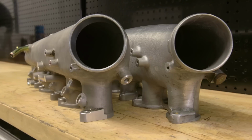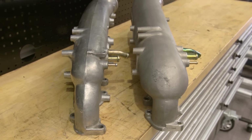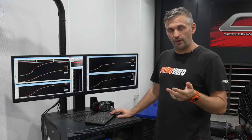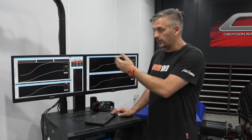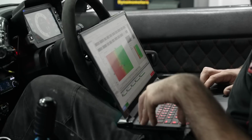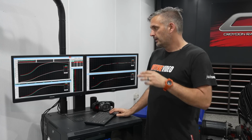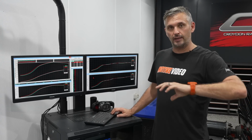No doubt you'll go back and watch our Nismo comparison to stock and see what happened there. But the way I see it is, if you make less than 1,000 horsepower, stock and Nismo are obviously fantastic. Do you switch to a Hypertune 6 throttle at this sort of power level with a medium frame turbo? Well, looking at this, there's probably no need to. But there are some benefits. It looks amazing. And secondly, we did have more consistent EGTs and obviously cylinder trim for injectors. Like the Nismo, it had pretty much perfect EGTs across the board, especially compared to factory.